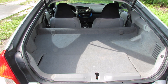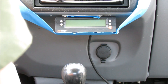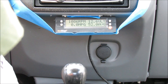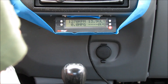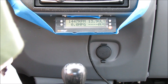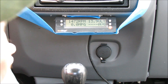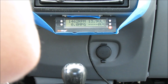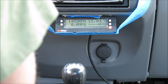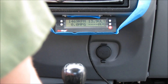Let's go for a drive and see if we've accomplished our goal. Look at that — we're now at 13.9 volts. I am running the air conditioner and the radio is currently on. You'll notice that the voltage will fluctuate — you can check this with your own voltmeter, or I'm using a scan gauge. Don't mind the blue tape, it's only temporary.